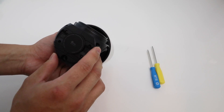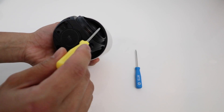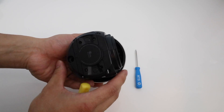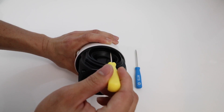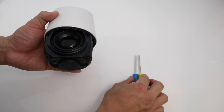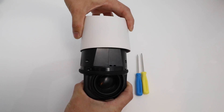Now looking at the Google Home, we need to use a — I believe a T9, I'll clarify in the description — a Torx screw right here. There's going to be, on the front of the device, two screws right in here, and then on the side, right there and right there. You're going to undo those screws, which I've already done, or it's possibly a T6. You're going to need both of these screwdrivers either way. Once you take that apart, the top just slides right off.